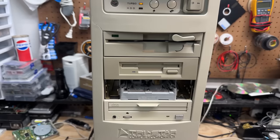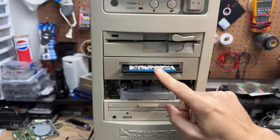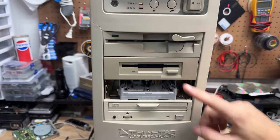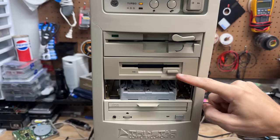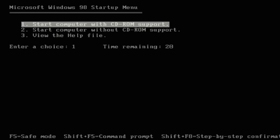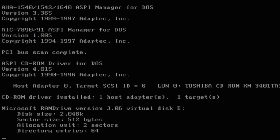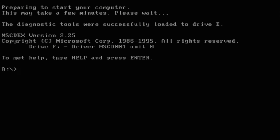Okay, I decided it's too much to try to save that DOS install — there's just not enough time this week. But I do want to know if that CD-ROM drive works, so we're going to need something with a SCSI driver. A Win 9x boot disk should have what we need. Oh and I swapped in a working 3.5-inch floppy drive.